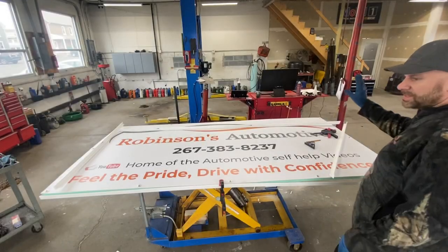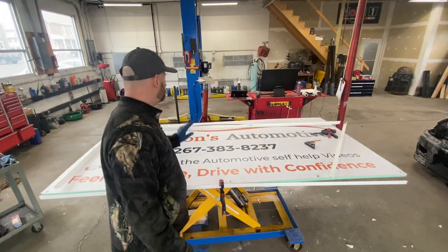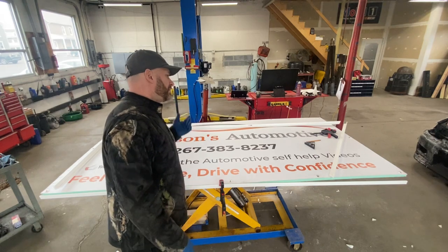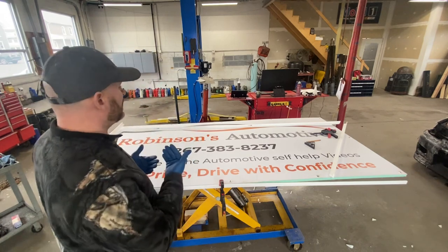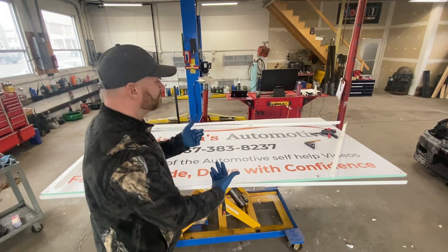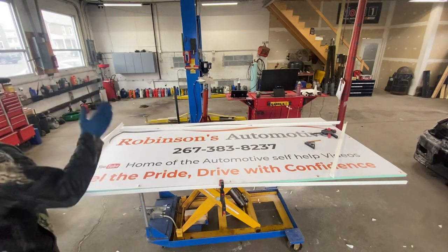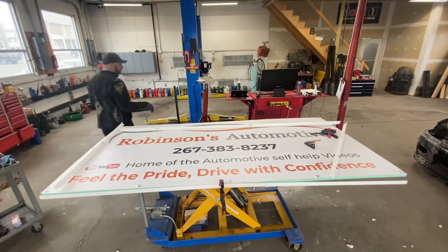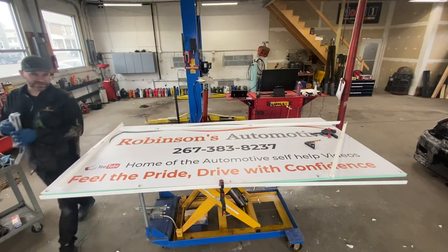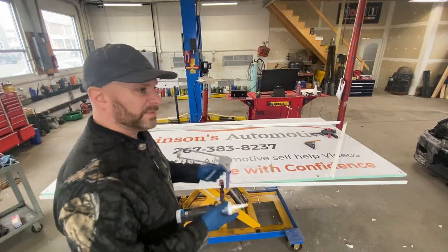I just had to knock that trunk job out real quick. Not really funny — they did the front brakes, rotors, and calipers, but the parts store gave them two left front calipers. So when the caliper was put on the right side, the bleeder was on the bottom — you'll never get the air out. He's back in business, but I've still got these rear brakes. Nobody had them in stock since it's Sunday, so he'll be back next weekend and is going to help me hang this sign as well.